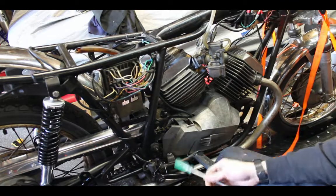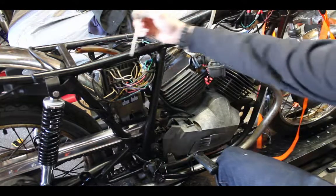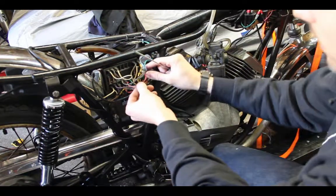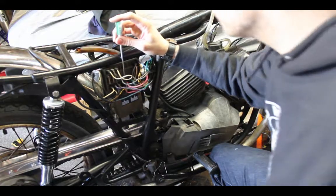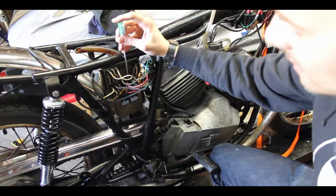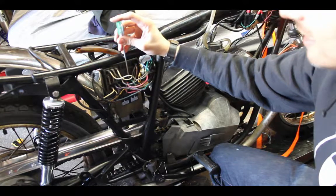It's all that to say, and the reason you're looking at this jumble of wires here is to point out the ridiculousness of this. So 12 volts, 12 volts, 12 volts, 12 volts, 12 volts. All of these things are powered from this little red wire that goes to the battery to this terminal right here. It is 5 millimeters away from the terminal, which you don't want 12 volts anywhere near. So if I were to somehow get this 12 volts to this terminal, I'd fry my ignition system.